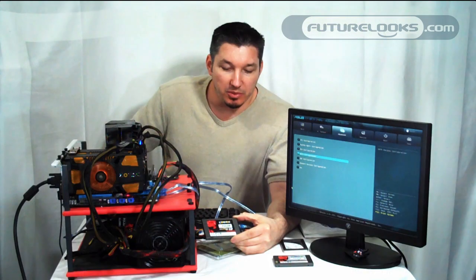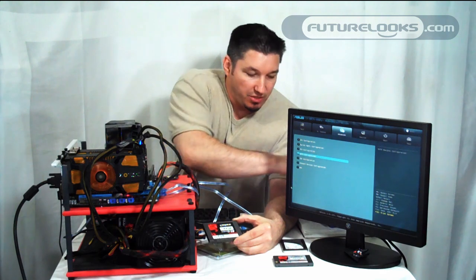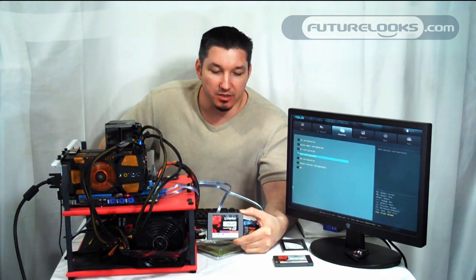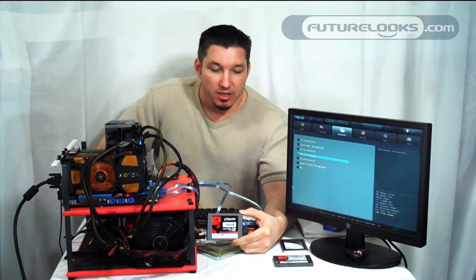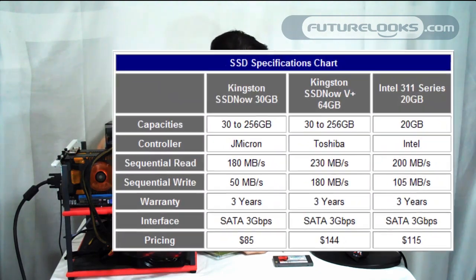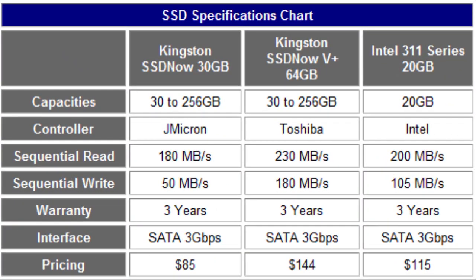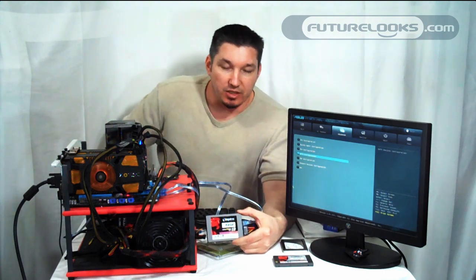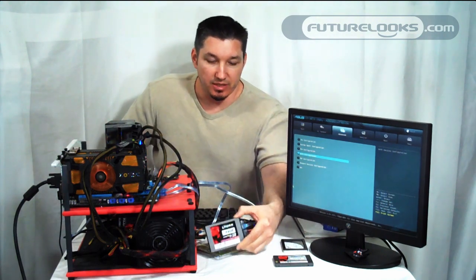This is a V-Plus SSD Now 100 series — a new one recently launched from Kingston that's been on the channel for a few months. You'll find that these have a 230 megabyte per second read time and a 180 megabyte per second write time, and that's sequential of course, based on the controller that's integrated inside.